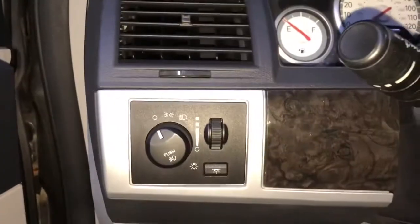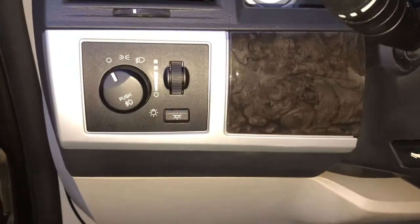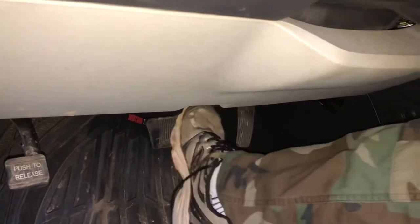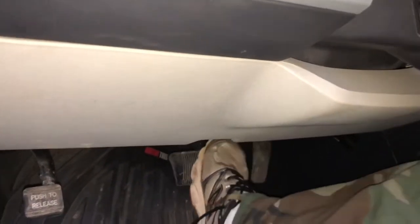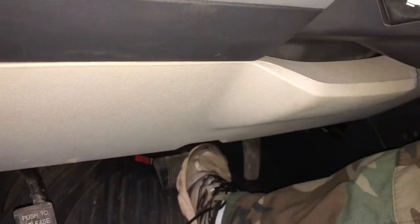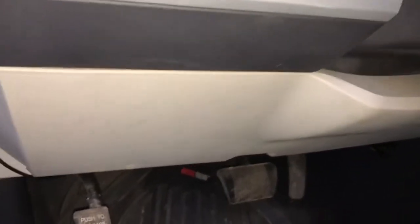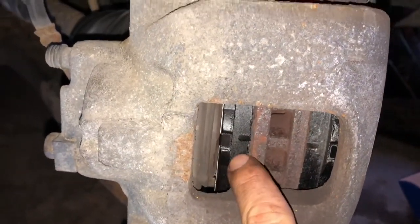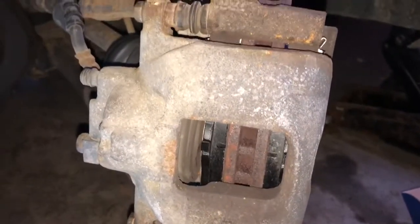With the ignition on, we should be able to pump that brake a few times until it gets firm again, letting us know that cylinder has come back out. At first it goes almost all the way to the floor — keep doing that till it starts to firm up. Now it's not getting much distance of travel, looking better and better. Feels pretty firm now like normal, so I think we're in pretty good shape. Just like we hoped, the cylinder has closed the gap — we'll get pressure on the brakes when we use the brake pedal.